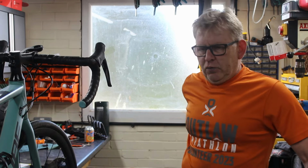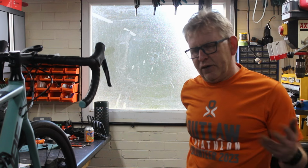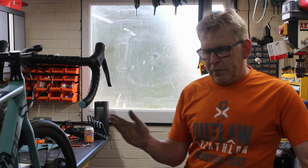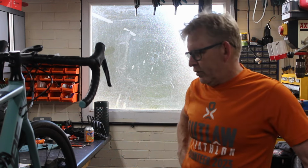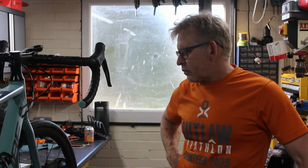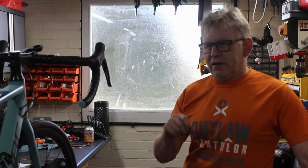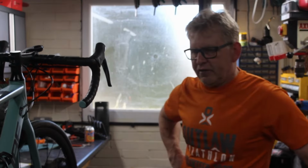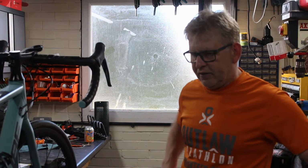modern. Because we've got all Scarifier cassettes, we have one set up as a scarifier and one set up as a cutter. So we'll pick the best set of all of them. I'll fix the bearings that have gone in some of the cassette units, and we'll send it on its way. I think the newer Kawasakis are easier to get parts for, even though they're not as well made. So I think what we'll do is take the older cassettes and send the newer cassettes down the road, because I think it's the cassettes that have the problem, it's the gear on the cassette.